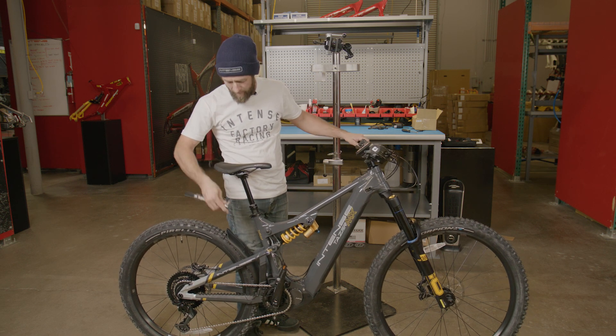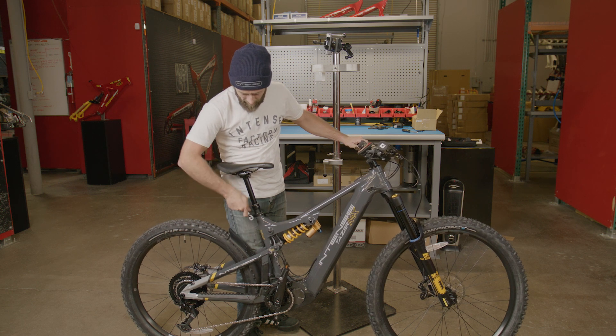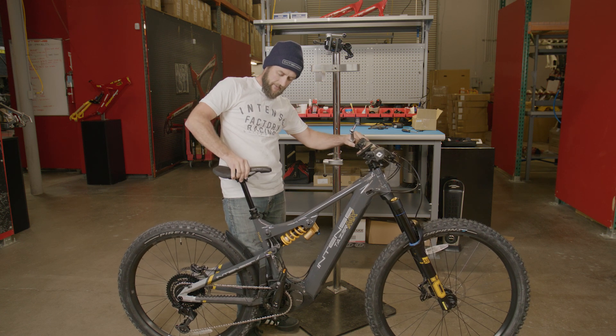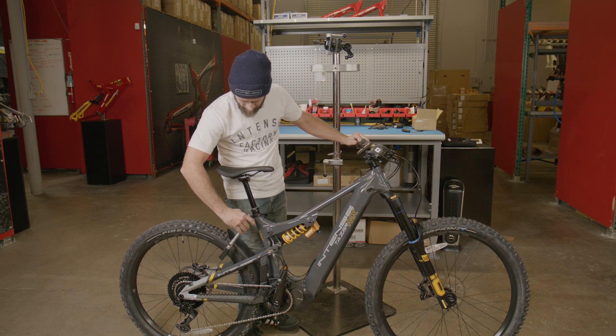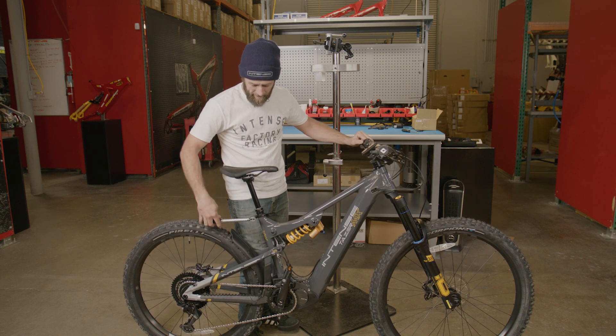If you are too low or too high we can make adjustments. We'll do that by taking a four millimeter Allen on the seat post clamp, going about half to three quarters of a turn to loosen our seat post. We can then slide up or slide down, make sure our alignment is good, and then re-tighten and torque our seat post clamp to six to eight Newton meters.